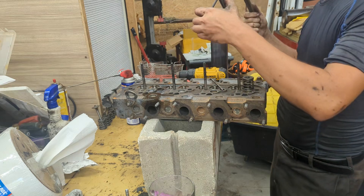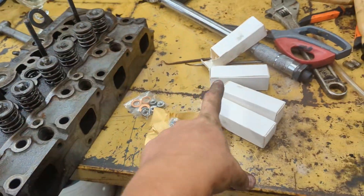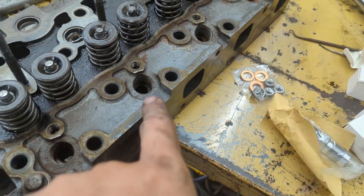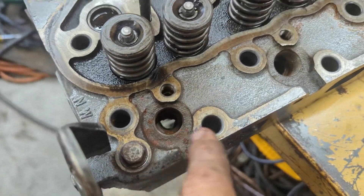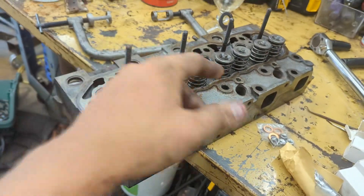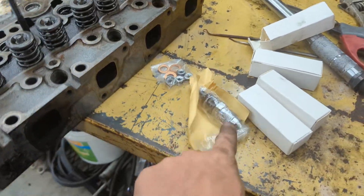We've got all the valves installed. I suggest not installing the injectors yet — install them once you've already put the cylinder head on the engine. The reason is that injectors are a bit of a pain to torque down, requiring a lot of torque, and it's just easier when it's mounted on the engine rather than trying to hold the head and torque at the same time. That's the end of the video. Just buy a brand new cylinder head — though again it depends on the situation. Please subscribe and I'll be uploading the last part of this diesel engine rebuild series soon, hopefully this week or next.